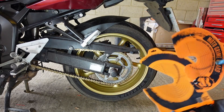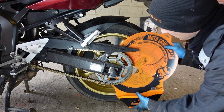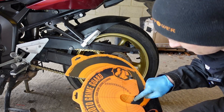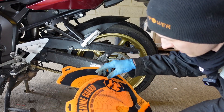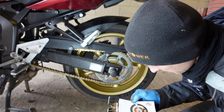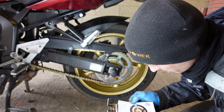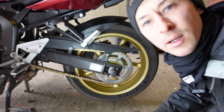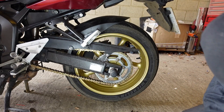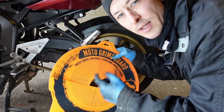I'm not even gonna look at the instructions — I'm just literally gonna fail at them. So I think the first thing I need to do is cut this out for the size of my wheel. Let's check the instructions: measure the diameter of the hub which holds the sprocket brake disc, take this dimension just behind the measurement of the hub, cut the guard along the suitable measure line. Once cut to size, insert it. I'll measure 155 by eye — we have 160, so let's go with 160. I'll cut this out and come back.